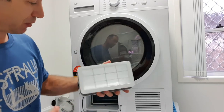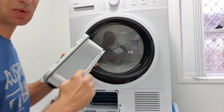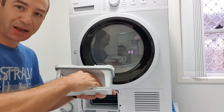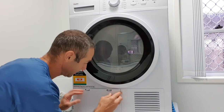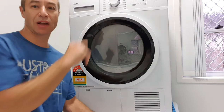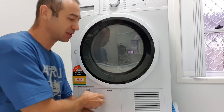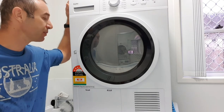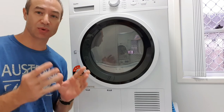These fins are very precious. If they get clogged, your dryer will stop working and it probably won't be fixed under warranty, because that's your fault for not cleaning it. The area that clogs is on the inside, sucked in from outside. What I do after every wash: I use a small handheld vacuum cleaner, vacuum the surface first, then remove what's inside and vacuum that too. When it looks clean, slide it back in and close the attachment. You could wait a month until the warning light comes up, but the dryer dries faster and lasts longer if you empty the filter every time.